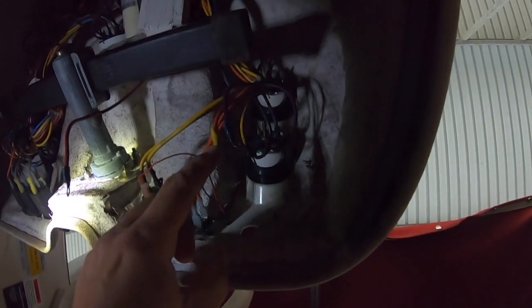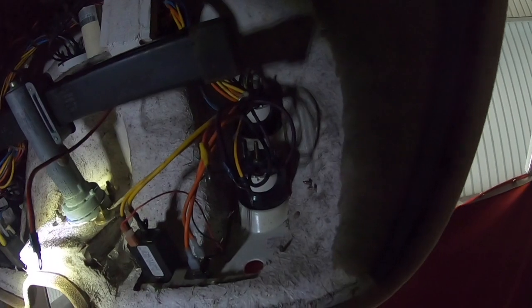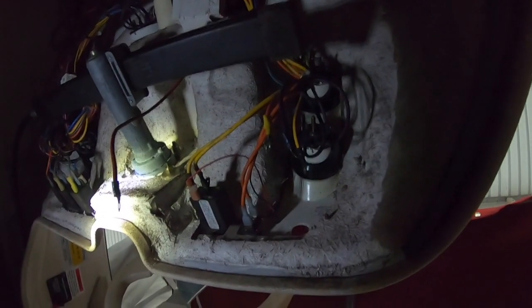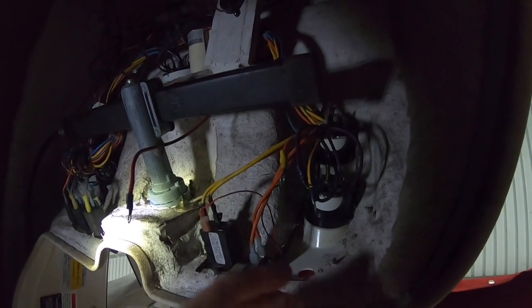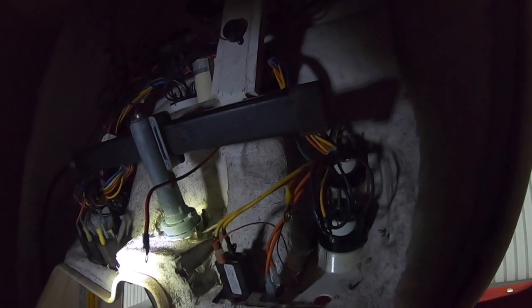There are four wires. From the research I did, they're all going to be a little different. You've got this wire coming from the battery, another wire — this one's red — and then a purple and a striped wire. The poles are labeled A, S, I, and B. B is to the battery — that's going to be this red wire coming from right here, it comes straight from the battery. The S for start, or I, is going here, and M, and then the other one here.